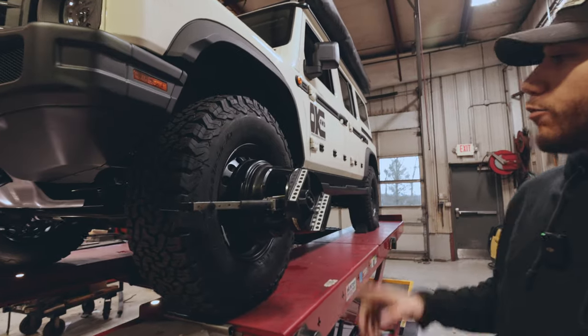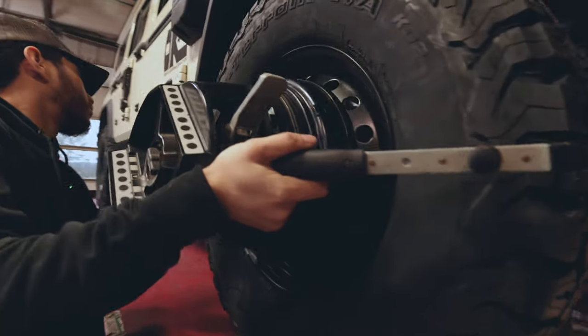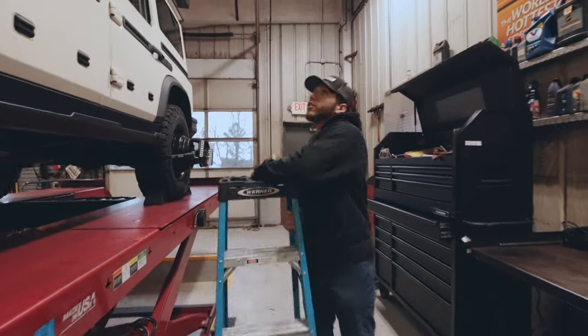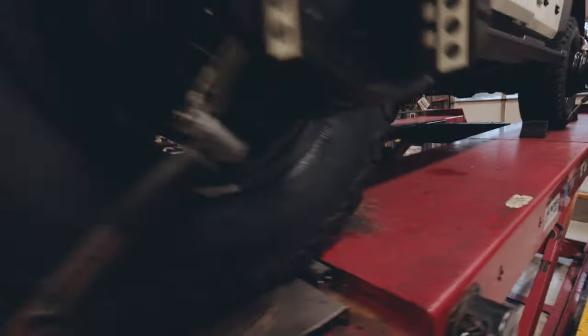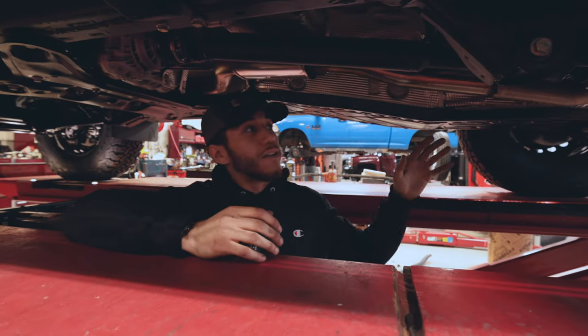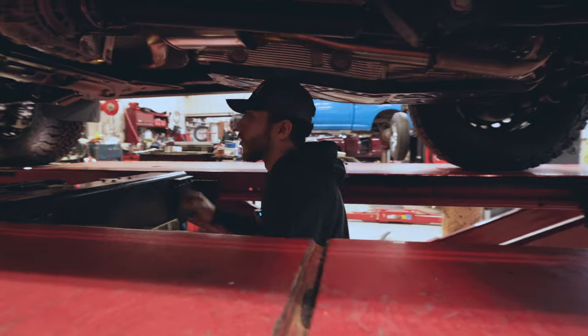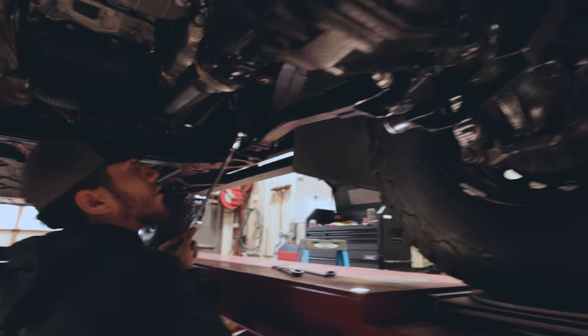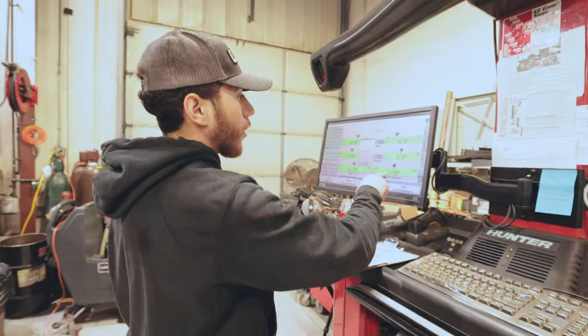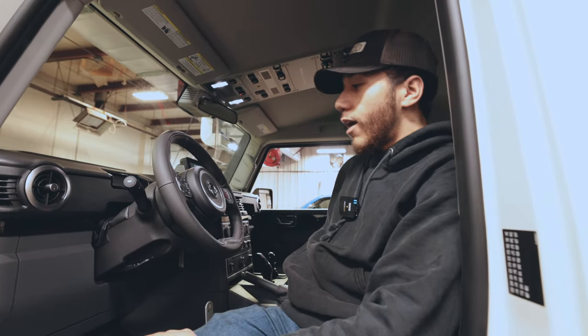These are our alignment heads — put them on the wheels and get them centered up. They show our camber, caster angles, toe angles, ride height, and wheelbase. Going to put it in neutral and roll it forward to get it compensated. First thing we did was come to the back of the truck and set the pinion angle, making sure we had a good driveline angle so we have no vibrations going down the road. Now we're going to go up to the front, set our caster and our toe, loosening the lower control arm cam to set our caster. We're off a little bit to the right, so we're going to go down and adjust that in the drag link.